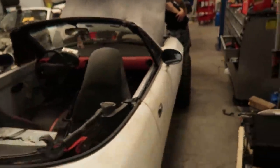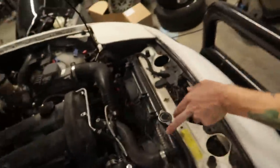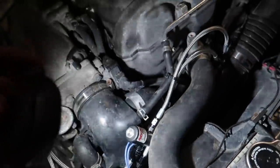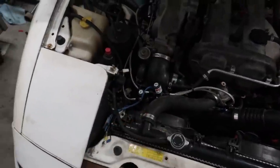We want this bottle all the way cranked open. Wow, it's cold up here — there's literally frost developing around this fitting. Actually, we might have a little leak. Yeah, we definitely need to attend to that — that's for sure a leak. We're going to fix that real quick. Just finished fixing the little leak. All it was was forgetting to put Teflon tape on that one little fitting. We did that and now we're all good to go.